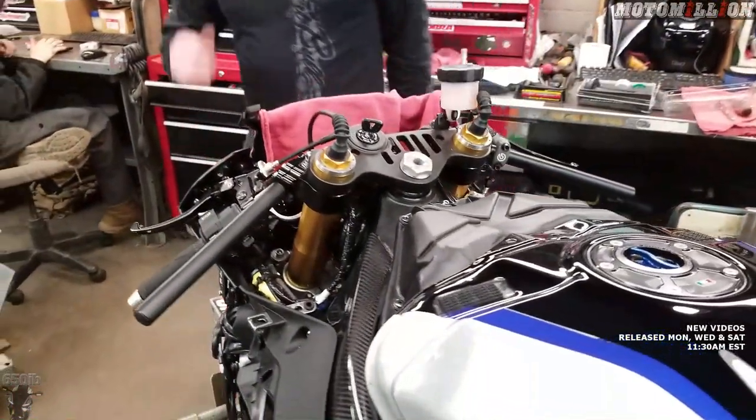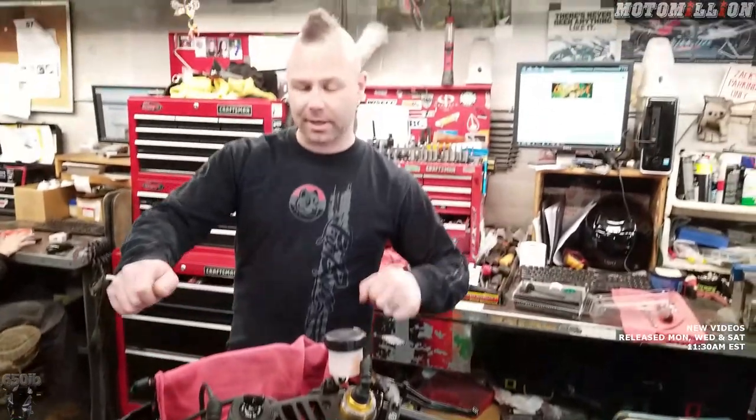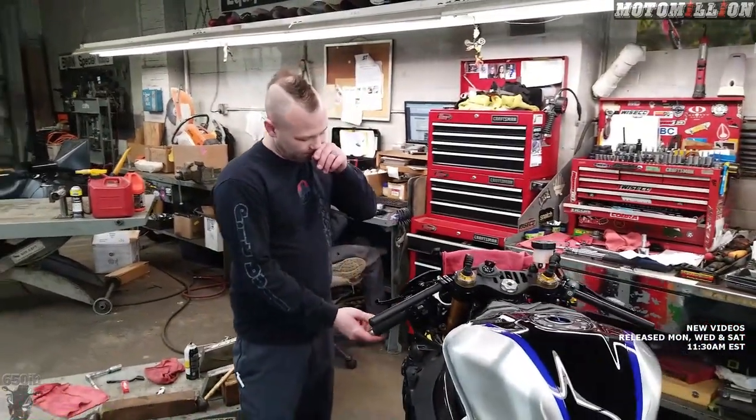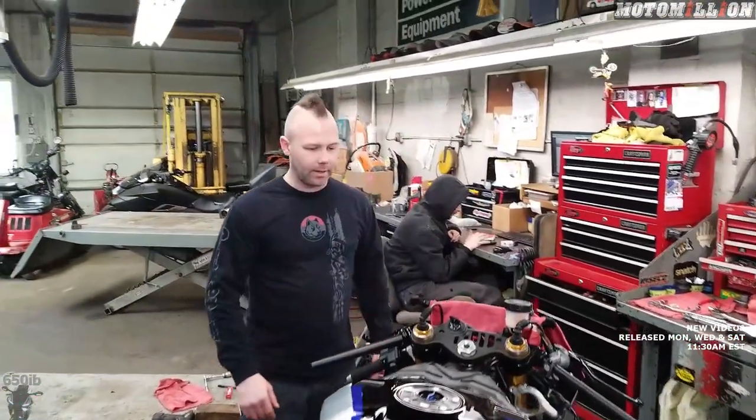Because it's ride-by-wire, the ECU controls the throttle plates. On the S1000 you'd just plug a wire in, but there's a lot of engineering involved to make a quick-turn throttle work on that bike. With cables you're able to do it at home. We've got our clip-ons mocked up from last time and need to check that everything steers and is clear. We'll peel off the remaining bits, pull the gas tank, and remove the airbox so we can get to the end of the throttle cables.